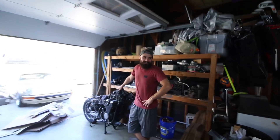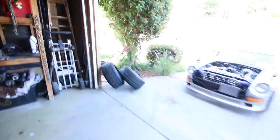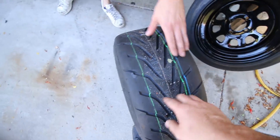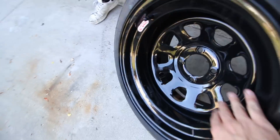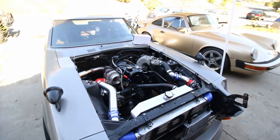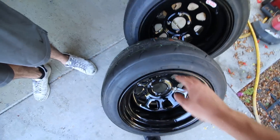We have beer in the mini fridge, but it's not on tap. We don't have garage tap beer, which we need. So basically we have the stuff to paint the fenders. Those fenders can finally go on now because we have the wheels and tires done - and a little bit of a stretch, boys. Not a lot of people wanted to mount these for us. These are 225s by 50s, 16-inch wheels - Proxes R888s and they're a little stretched. These wheels are 16 by 10 with 25 offset diamond racing steelies. We got all four of these for about 500 bucks - dirt cheap. Gets the look that we want and the tires that we want. This should be more than enough rubber at least for a little while until we really turn that boost up. These are notorious for not wanting to spin - very grippy - and we'll see how they perform.